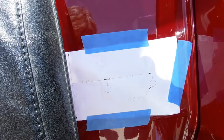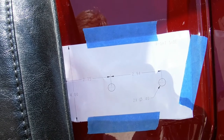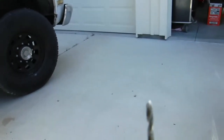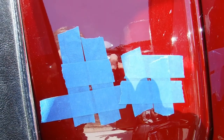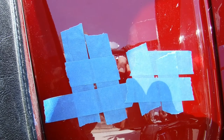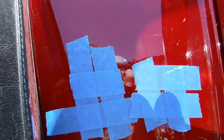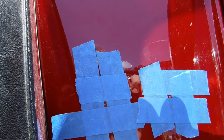Next step is to drill a couple of holes — they say use a punch, but I like to use a really small drill bit so I'm a little more accurate. As you can see, I just barely nicked the fiberglass; I don't want to go deep, just make a mark. Then put masking tape on it — that prevents chipping and cracking of the paint as you drill. Be very gentle with the fiberglass.